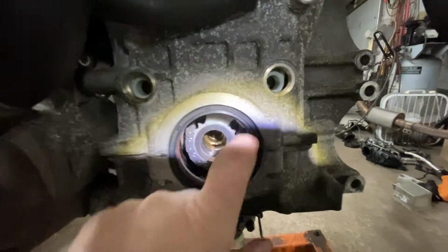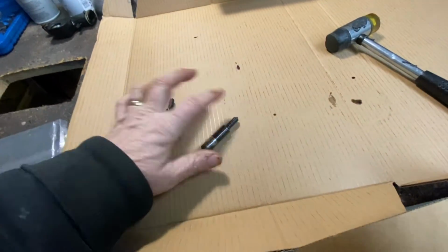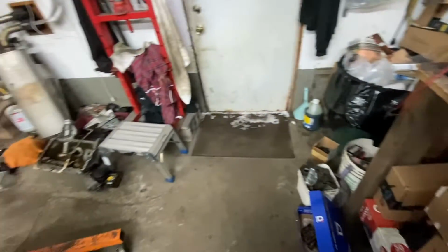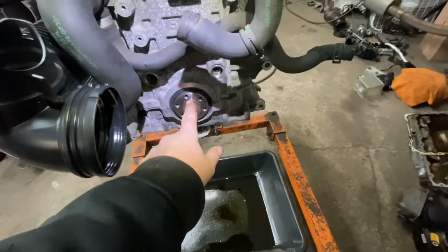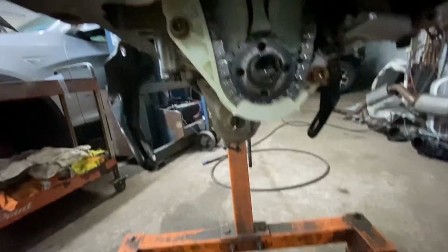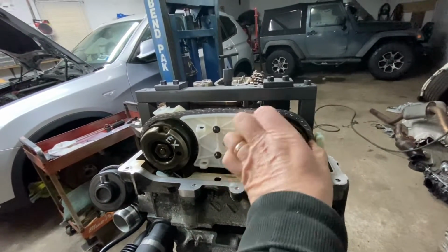All right. Now we're gonna put the pins that hold the rails. These three. Okay. Oh, sorry. And then we'll just take it from there. Now, once you get the chain on the top, like I told you, and you put the crank piece over here in place. This is not tight. Okay. And you look underneath. This is still locked in place. All right. Now the chain, everything is loose. See? This whole thing spins.